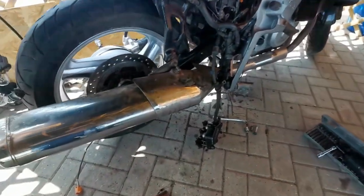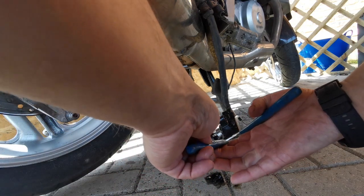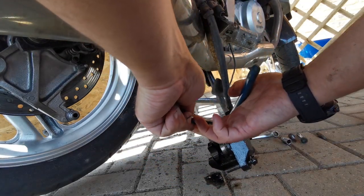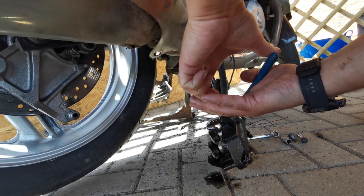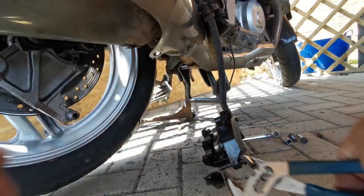What I'm going to do now is stick the footpegs back on, run the cables down for the brake caliper, and give the brake caliper another clean with a toothbrush and a bit of wet and dry to get underneath the caliper pistons. I've given it another going over with the toothbrush and some brake fluid. Now it's time to push the pistons back using my Honda-approved piston retraction tool. And the answer is no — it didn't work.